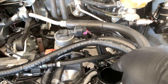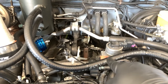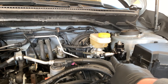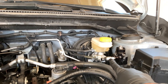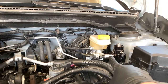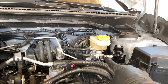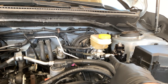That plugs into one of the TGVs — we're going to use the driver TGV for that. You'll see the wire run up there for the rear O2, which is a power source to it. We also have our regulator mounted here with a sensor on it, so we are going to be running the Cobb fuel pressure sensor as well so we can monitor everything on the Access Port. The other nice part about having the sensor is you can put a failsafe — so with this car, it's going to have a map switch from Hyper Blue. The tuner can put a failsafe on there so that if we don't hit a certain PSI or fuel pressure it will just put the car on wastegate pressure boost.